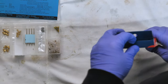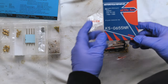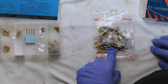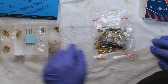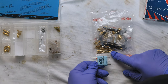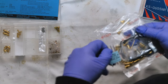This kit I got off eBay, and I'll put a link to the seller down below. It's a Keyster. The model number is KS0655NR. This kit I would say is probably in some ways more complete. It's got additional jets, gaskets, and the needles are a little bit different. You can see the Factory Pro has needles that look very much like the original, whereas this one has brass ones, and not shaped quite the same either.